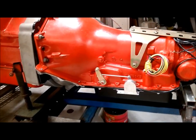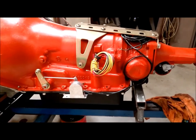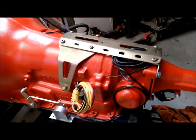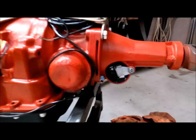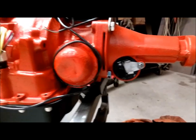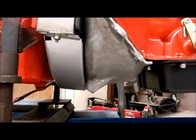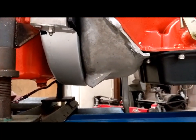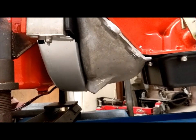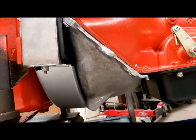I've also gone to the trouble of hooking up the shift indicator mechanism, the torque converter lockout, and installed the bracket for the shifter. The other item installed was the electronic sensor for the speedo. And underneath, a homemade cover for the original Cadillac flex plate — I've utilized a General Motors aluminum cover that I believe comes from a T200 transmission.